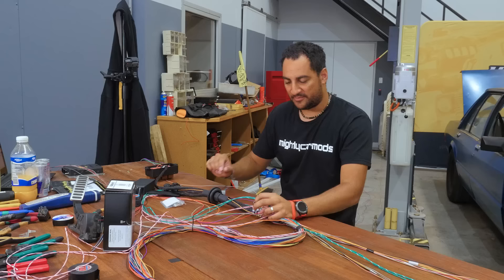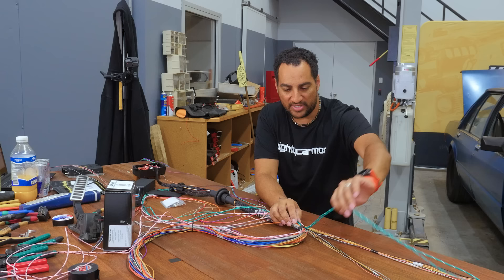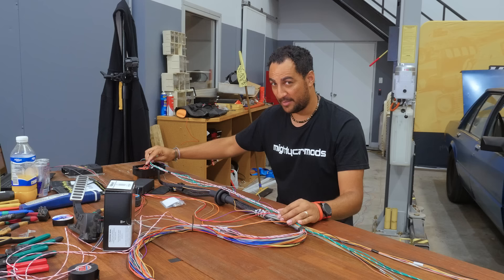I'm just going to break apart the cable tie and braid and grommet, and we're going to try and feed the wires back through the braid that goes to this fuse box, as neatly as possible. I've pre-run a couple of lengths for the thermofan and made a note of it in my document. I'll show you the document and the changes I make — so we can keep a very good note of what wires we've used, what colours they are, and where they're going.